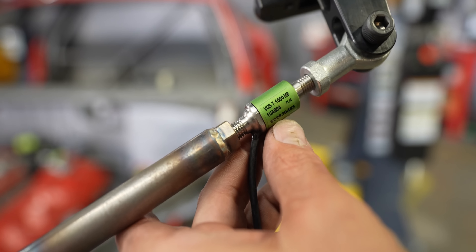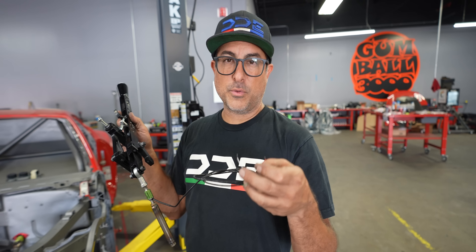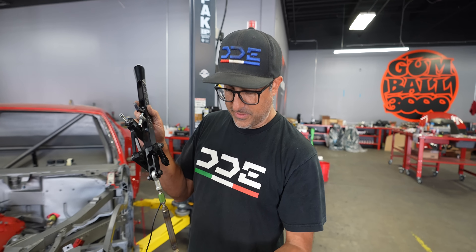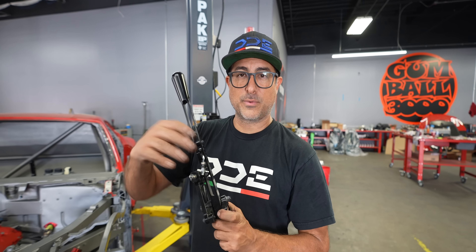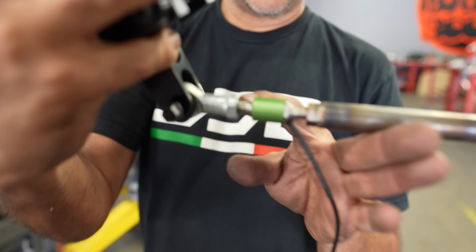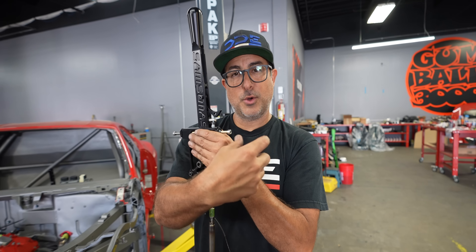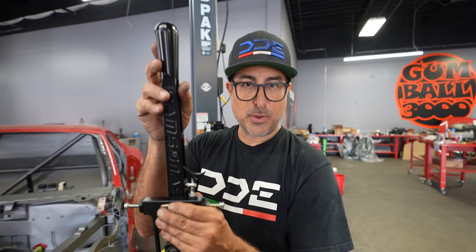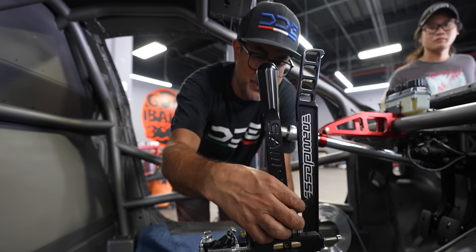Here's the strain gauge. This little sensor reads force through three wires: a 5-volt supply, a zero-volt sensor ground that's read through the ECU so it's 100% consistent, and one signal wire. As you do your shifts, it'll read 3 volts, 3.5 volts, 4 volts — reading all the way through that sweep, kind of like a potentiometer under load. I've already made this linkage. I'm going to put a couple of jam nuts on here so that once we get in the car, we can adjust it properly with no load on the shift mechanism at all.